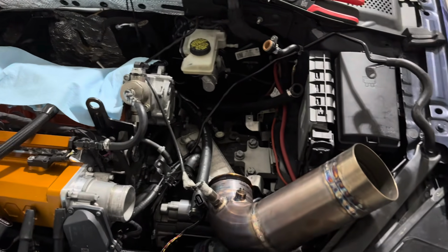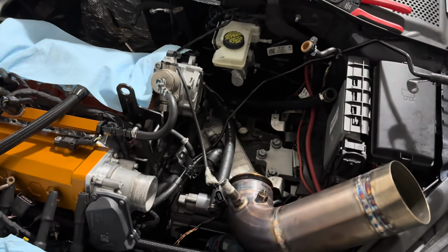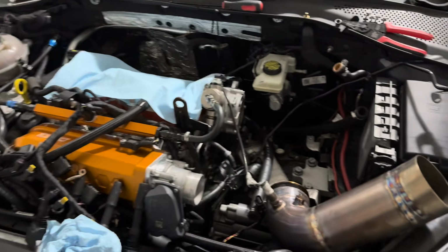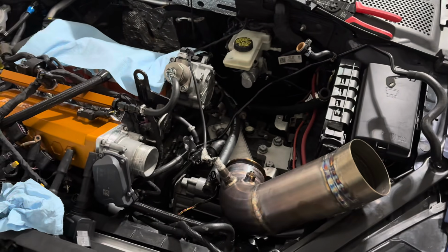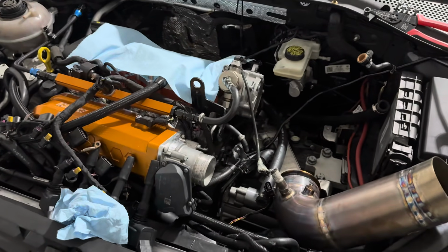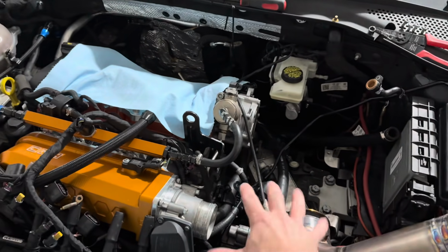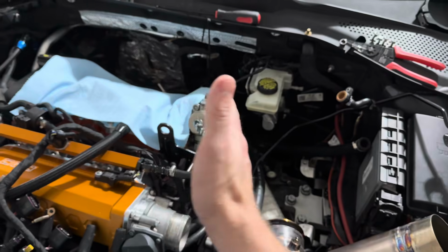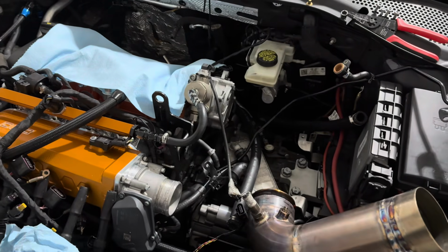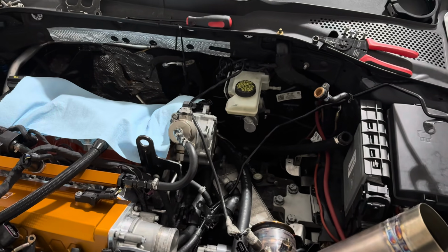mathematically anticipated. I was expecting around 400 to 500 RPM difference compared to the SRX 950 with this setup, even though it's a slightly larger compressor wheel. But we're able to spool the turbo around 5,000 RPM, which is a lot sooner than I want it to be, almost. I don't really need it to hit full boost until about 6,500, just because the transmission only drops from 8,650 down to 6,500 on the 3 to 4 shift, and the 4 to 5 shift it only drops down to 6,700. So it's almost not really needed for the turbo to spool up that quickly.